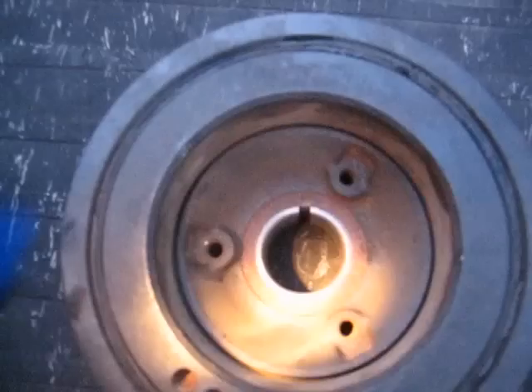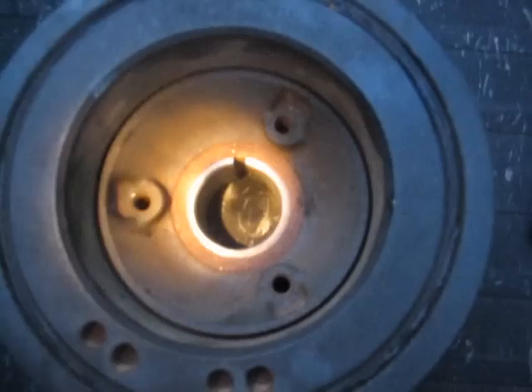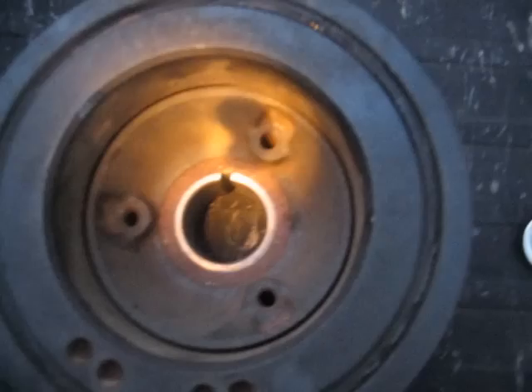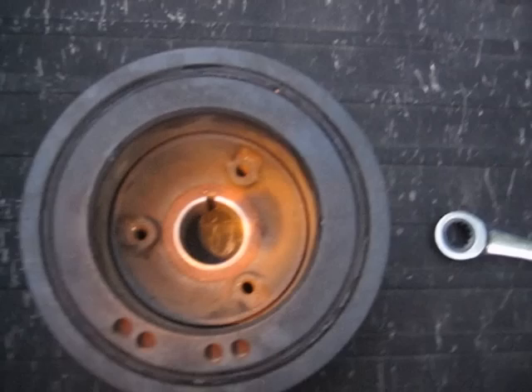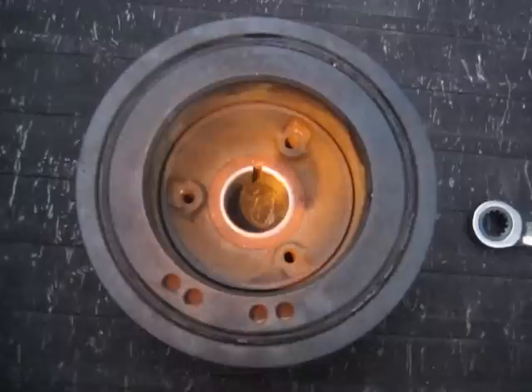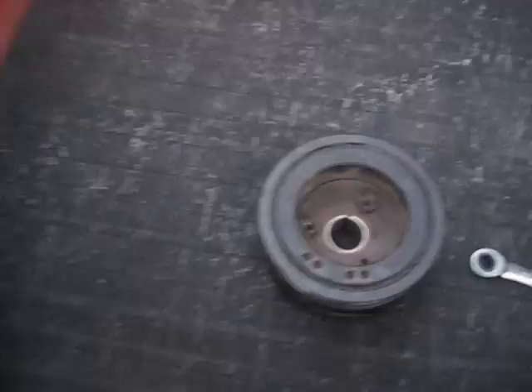On the harmonic balancer, your puller's going to go in those three bolts right there. When you install this, it's going to sit straight up and fit inside a key that's already inside the crankshaft. When you go to put this back on, do not under any circumstances use the center bolt to put that back on. You can use a hammer or a special installation tool, but do not use the bolt - it can break, strip, or cause a whole bunch of problems. That's the reason when I did my 89 Ranger I had to change my crank because I snapped the bolt off halfway into the crankshaft.